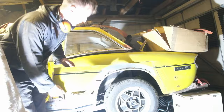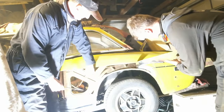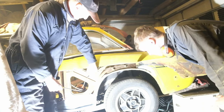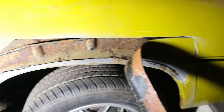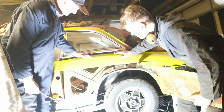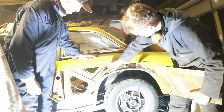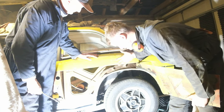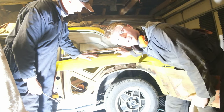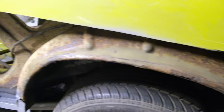After a little bit of cutting action the wing just peels away literally. Looking at this wing, it hasn't actually had a rear quarter replaced before — you'd see where the panel had been joggled in. It's not actually too bad underneath. The main reason we chose to change this rear wing is because of all the rust around the wheel arch and between the two skins — if you don't change the panel you can't get to that rust and it'll just creep back through the new spray job.